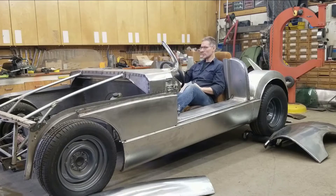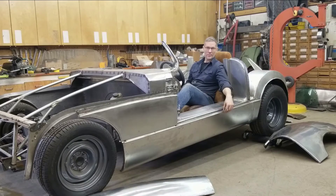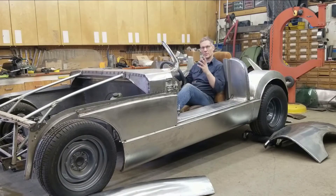Visibility is perfect. I was going to put the windscreen in place, but we don't have those rubber grommets mounted and I don't want to risk chipping the glass if it sits on the bare metal edge, so we're going to leave that for now. I dropped the seat in to get a feel for how things are. We spent a lot of time working on the interior structure, completing all the spot welds, dressing everything up, and finalizing everything before it heads out to primer — not here though. All the areas going to be covered up afterwards, so we're going to take the rockers off, shoot everything inside, seal everything so nothing rusts, and then reassemble the exterior shell over top of the structure.